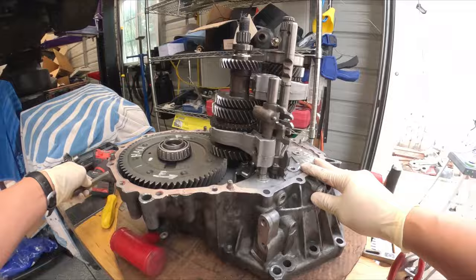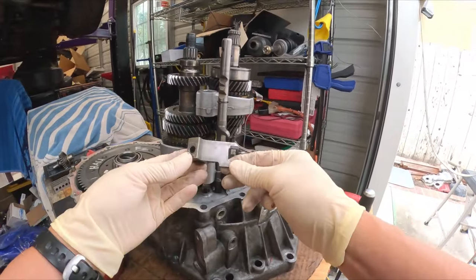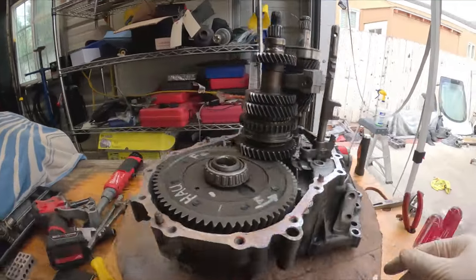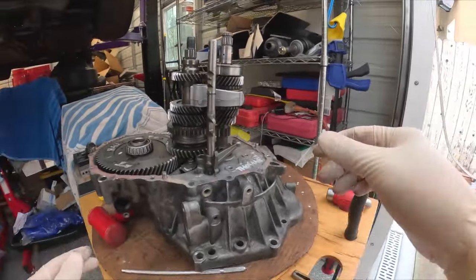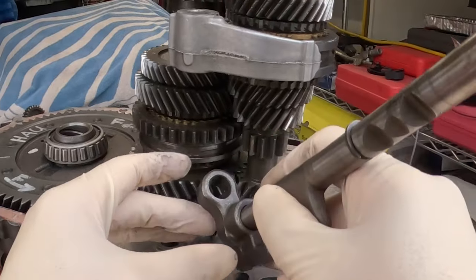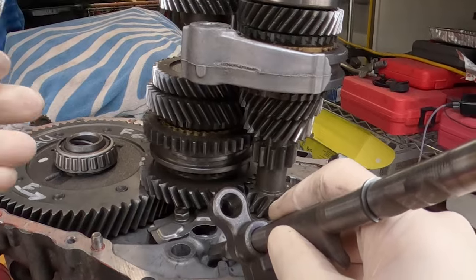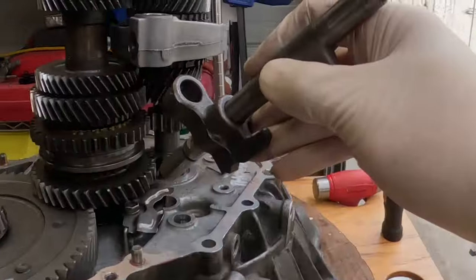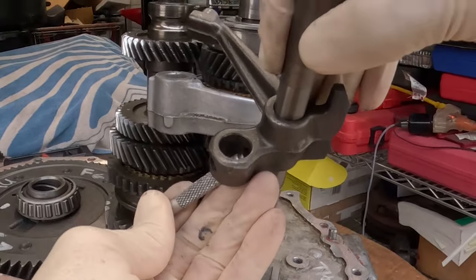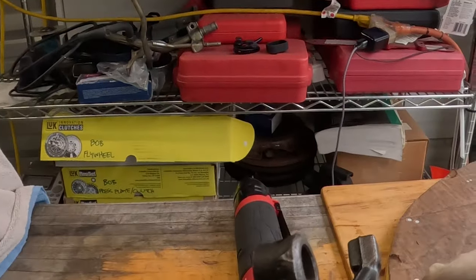Let's put this down and pull out shift shaft one right here. We'll get the number one gear shift head and the 1-2 shift fork. Now here's where we have to be really careful — grab the magnet. You can actually see the spherical balls in here. Because it's at an angle, I'm going to rock this back so the balls don't fall out. You can see that ball right there — I'm going to pick it up with my magnet. There's the first one; let's put it away. There is a second spherical ball in here. I'll put the magnet in and dump it like this — you'll see the ball fall out. There it is. Be careful with these spherical balls, don't lose them, put them in your tray. Then this thing just comes apart.